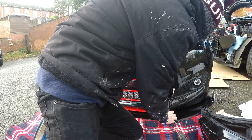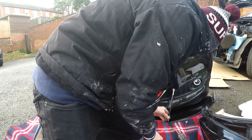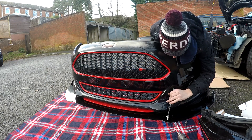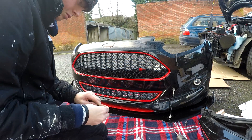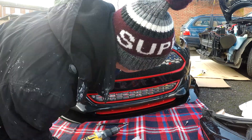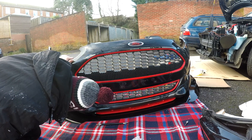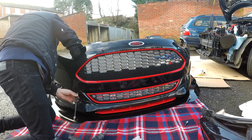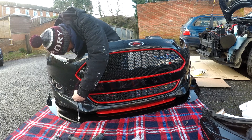Anyway, I put the bolts in each side and did them up — pretty easy. The next thing was to decide where I'm putting the splitter rods, make sure they fit, drilling into the bumper, doing the nut up on the back, then flipping it over and drilling underneath the splitter for the splitter rods. I tried to get everything equal and in line — obviously the last thing you want is for things to be wonky with splitter rods. I think I managed to complete that.